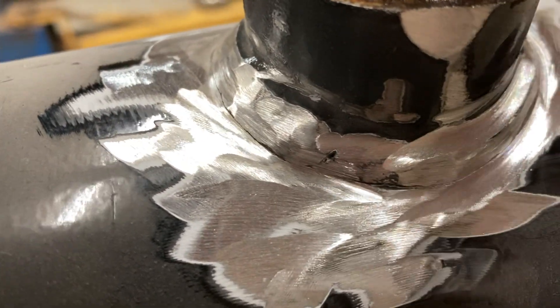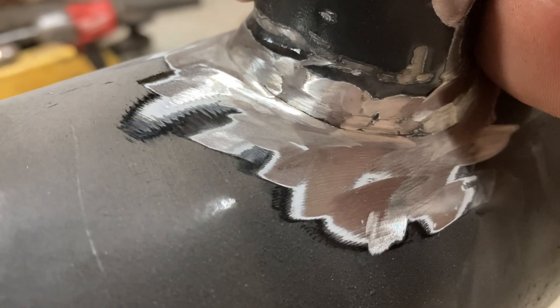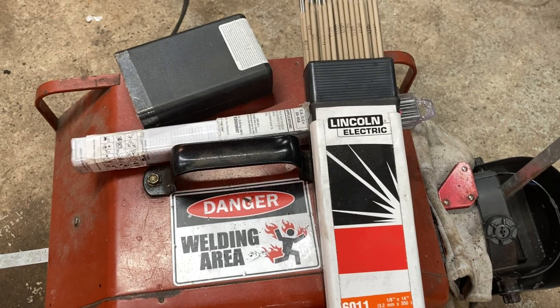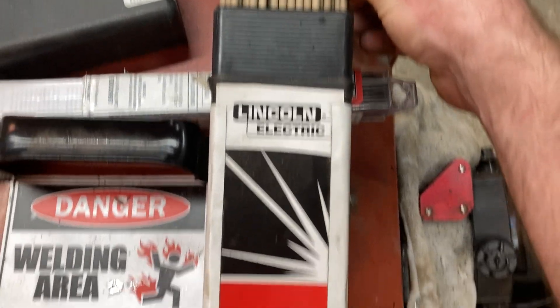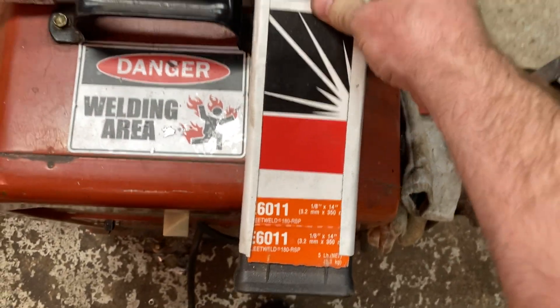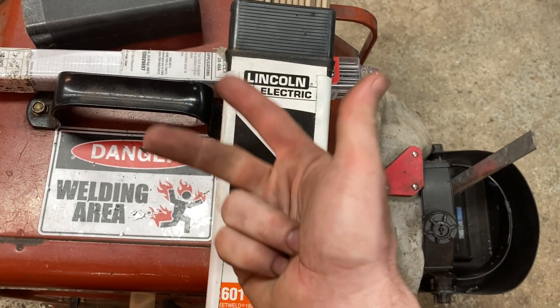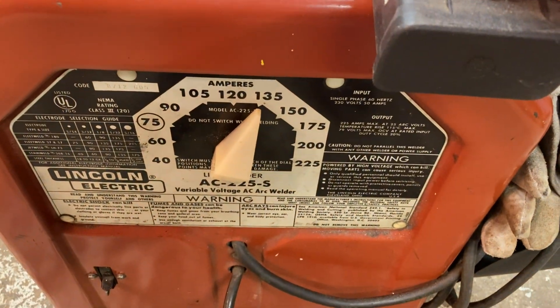I'm not sure if it's coming up on camera, but you can actually see the crack when I manipulate the nub. You don't want to weld with any traces of ATF in there. I do wish I had a MIG — I have an AC buzz box. It'll be fine. 6011: when you need your welds to be real strong, real easy, but you don't need them to look real good. I have no idea how thick the cylinder wall is, so I'm guessing at 135 amps.